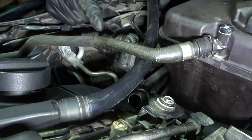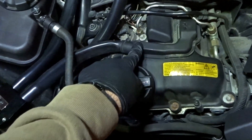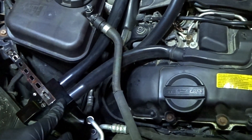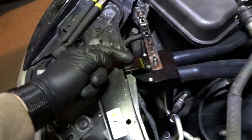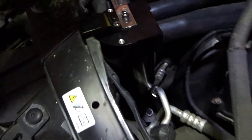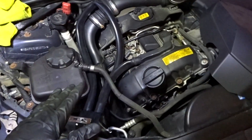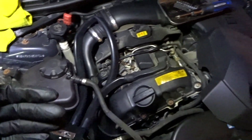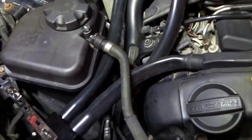I mocked everything up and cut everything to size. Right now I have the outlet going into the catch can inlet, and the catch can outlet going up into the intake. I put on a bracket, ran the screws through, and everything is firmly mounted — not moving at all — using the bracket piece that came with the kit. I'm pretty sure my hood should still close; it's not protruding too much. I just want to test it out and see what happens before making any further cuts.